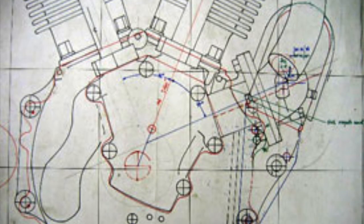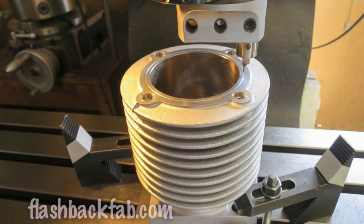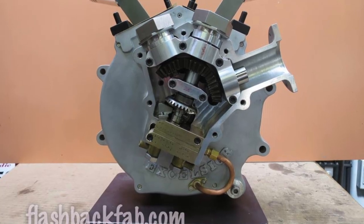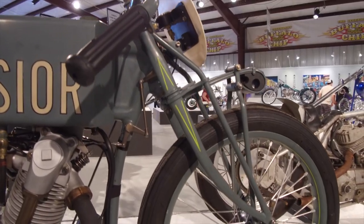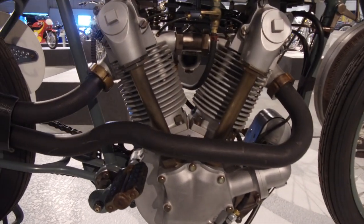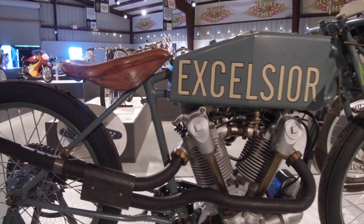Then I spent four months on AutoCAD figuring out how to fit pistons, flywheels, oil pump, and all that inside it. I made the outside of the engine look like a 1919, but inside I made it as modern as I could. It was a huge learning curve because I had to learn how to build a motor — something I always wanted to do since I was 18 working in an engine shop. There was metallurgy, how to fit everything into a certain size, choosing parts, cam profiles, and compression ratios.